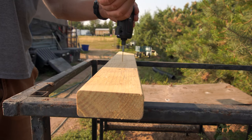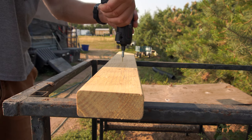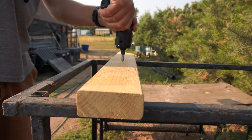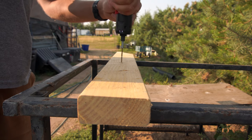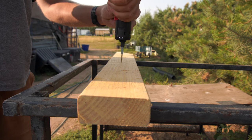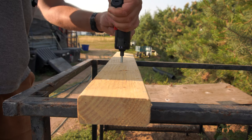Now, let's talk a little bit about what you can expect to be able to do with the screwdriver and what you can't. The electric screwdriver is capable of using hex shank drill bits, and it was able to drill into a pine 2x4 fairly easily, up to about the size of a 5/16 inch bit. Drill bits bigger than 5/16 inches will still drive in, but you're not going to be setting any kind of speed record.